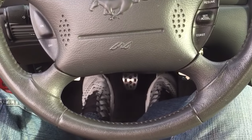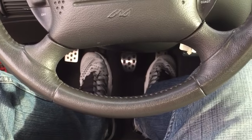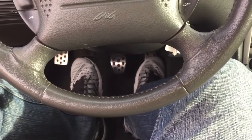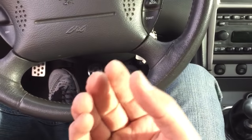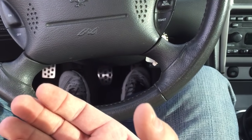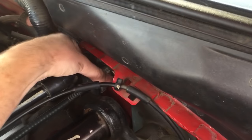The other way to adjust the clutch is to back off the throwout bearing so it's not touching the diaphragm fingers at all. Then as you push in the clutch, you'll hear a brief chirping sound for that split second, and when you let go it won't be touching at all. To help with this, there's a free play elimination mod — basically a spring that goes underneath on the transmission, pushes the clutch fork, and keeps it firm. To adjust this way, turn the adjuster clockwise until the chirping goes away.